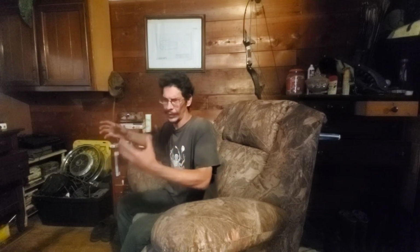If I'm all the way on and I let go, I would prefer it to snap back a little faster and freer than it does. I don't like any kind of hesitation or friction in there, so I need to address that. And I think a new fresh set of cables will accomplish that. Plus carb rebuild kit, master and slave for the clutch rebuild kit, and all the mechanicals will be sorted out on this bike at that point.